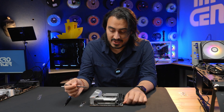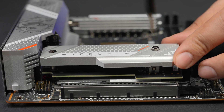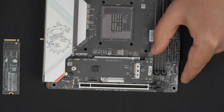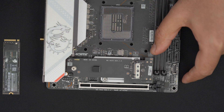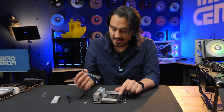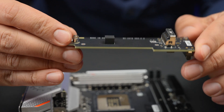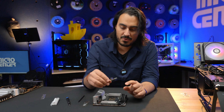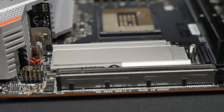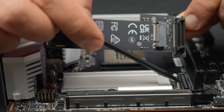We have a tiny board here, and the M.2 SSD is going to go right under this heat sink, so first we'll take that off. This is where our M.2 SSD goes. The M.2 connector is on this little device that pops out — it actually has an M.2 slot on either side, which is a clever way to fit multiple NVMe SSDs into a small form factor board. There's a thermal pad underneath and a thermal pad on top as well, so thermally you're covered either way.